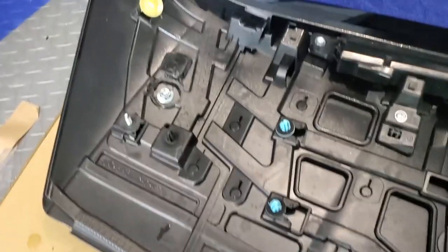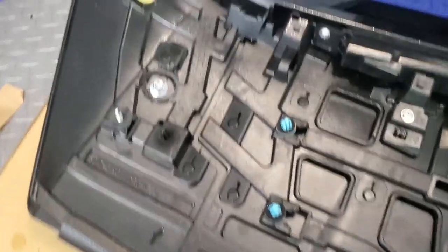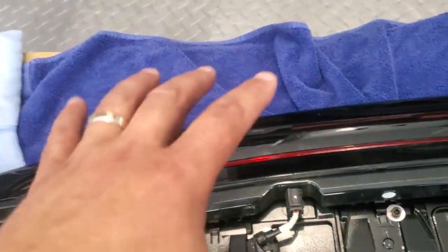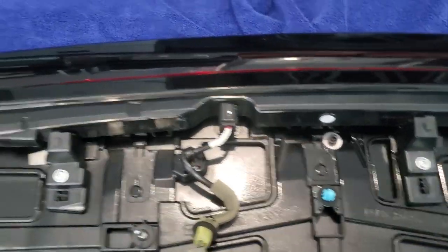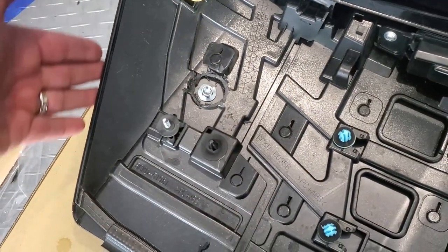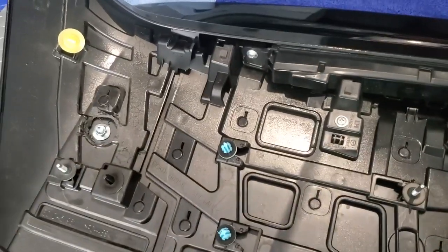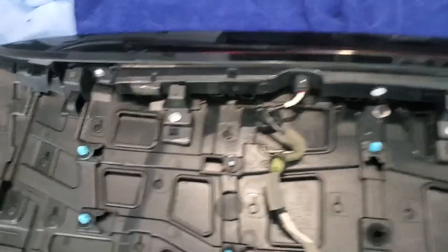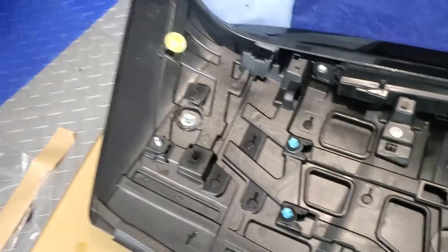With the holes drilled out, I test fitted the spoiler — I already peeled the double-sided tape off and lined up the holes perfectly. I dropped it down on this surface, using the box it came in and a towel. I lined my holes up perfectly here, here, and here, didn't tighten them all the way, picked it up and looked at it. It's all perfectly flush on both sides. Then I went in and torqued them down to about 10 or 12 pounds like it said. Now I'm ready to install the spoiler back onto the Mazda — I just need to replace these little clips first.